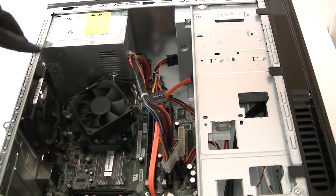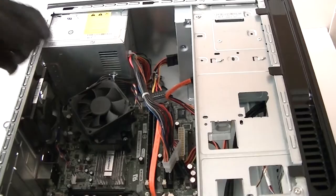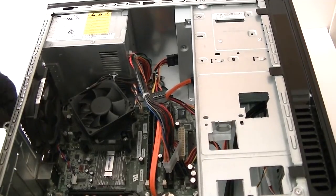Same with the four-pin. To get the four-pin, you got to remove the rear system fan right here — it's a 92mm. Get that removed, disconnect that three-pin. And there's going to be four screws in the back — use a Phillips screwdriver. Get it removed.